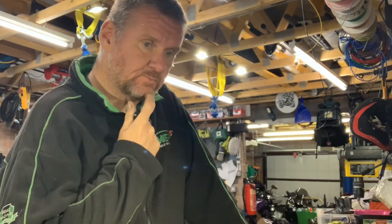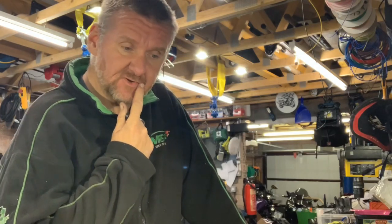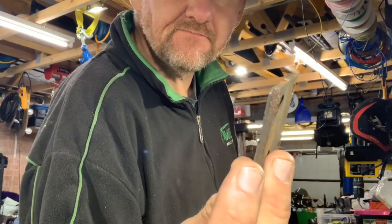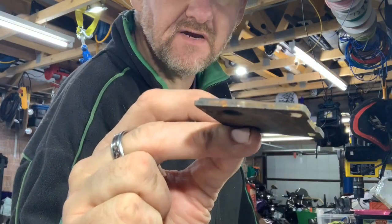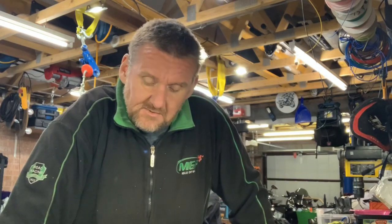I can put all the front end back together with the brake lines. I've got brake pads coming and I've already got the rear brake pads sorted. I'm just waiting for the rear disc because the rear was totally knackered — the pads had been running metal on metal and the disc is like a really deep-grooved record. That's only going to generate heat and brake fade on the rear. Anyway, I'm going to start on this carb and see where we go.